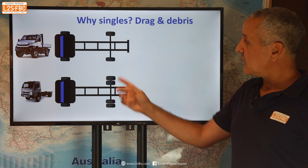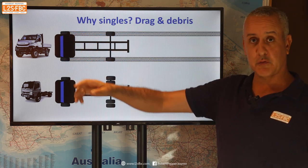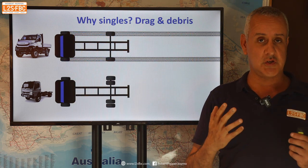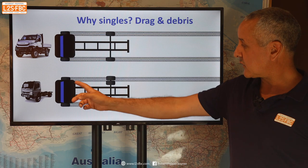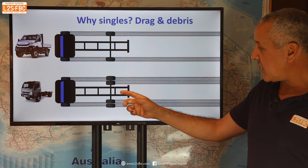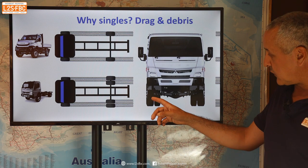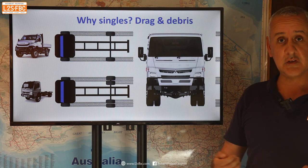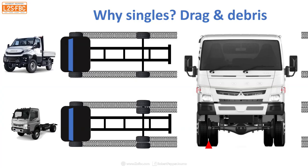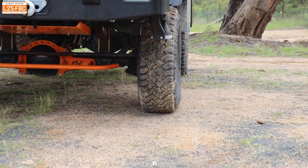So why is that? With a single tyre you can see that the front wheels follow exactly the path of the rear wheels — just two sets of tyre tracks — which is great in soft conditions because that minimises your rolling resistance. When you've got duals, the front wheel marks and the rear wheel marks create four tracks. The front wheels are pretty much lined up with the outer rear wheels, but you're still increasing your rolling resistance, and you can end up with debris caught between the two rear wheels. That is why you do not see pure off-road vehicles with dual rear wheels.